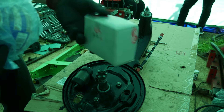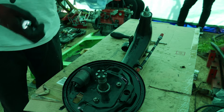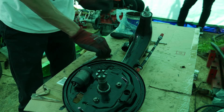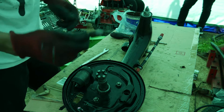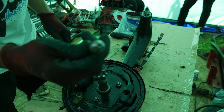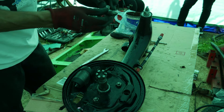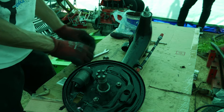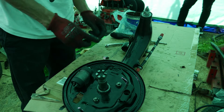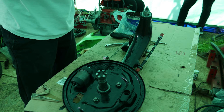That Delphi wheel cylinder is now fitted. Now I'm going to put the cam set in. Like I showed you before, the cam goes in there — it's like a cone with four flats on it to adjust these wedges out and push the shoes when using the handbrake. To do this, I'll put a bit of copper slip on the thread.